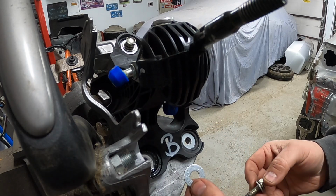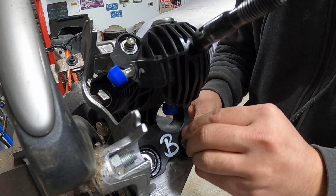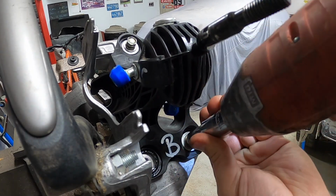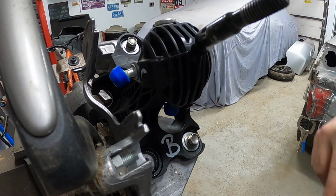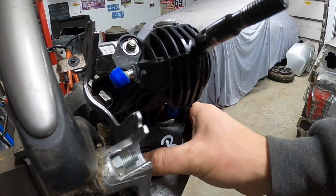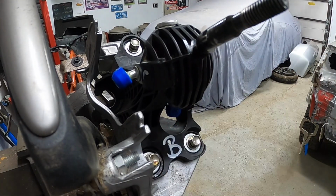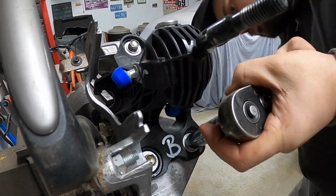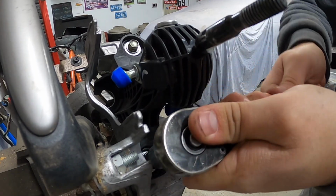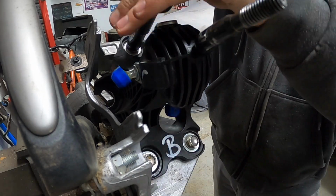So now we'll take our 7/8 outer diameter washer and our 1-inch bolt and install them. Not have it fully tight yet, as we still want to be able to install this one without too much struggle. Now you want these to be tight, but don't over tighten them, as you don't want to strip the threads, but you do want this washer to squish down a bit.